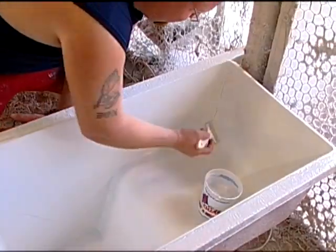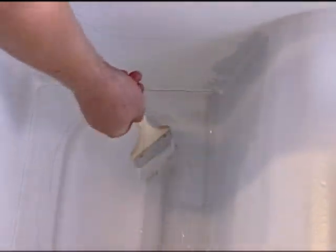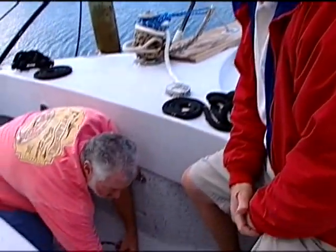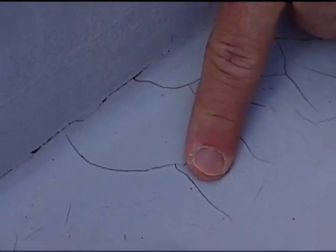Can you touch it up with a brush? Just get a little mixing cup, put some gel coat in there, and brush up those light spots. What happens if it's too thick? The same thing — that's bad, because then you'll see stress cracks on boats. The gel coat has no strength; that's where the fiberglass comes in, so it can crack on you.